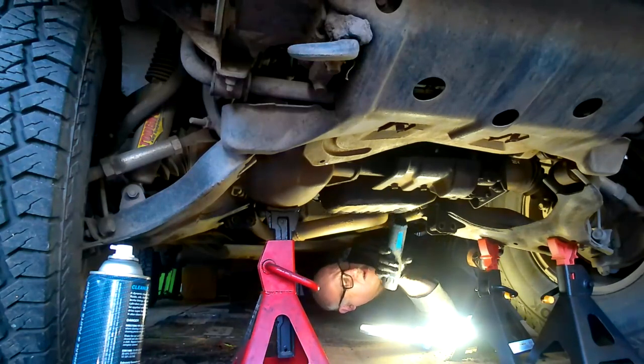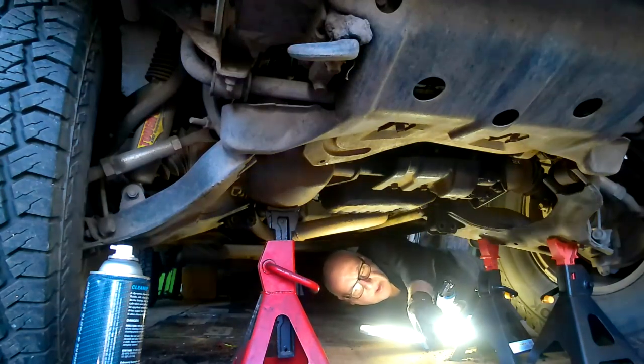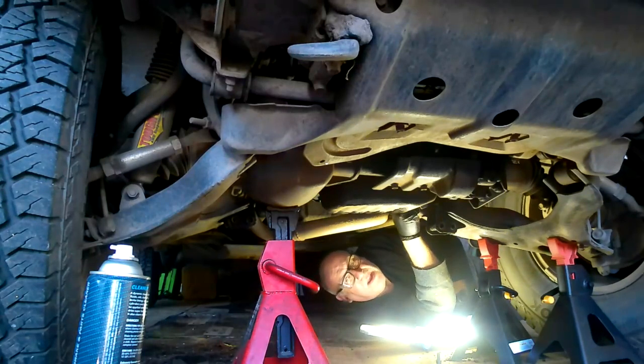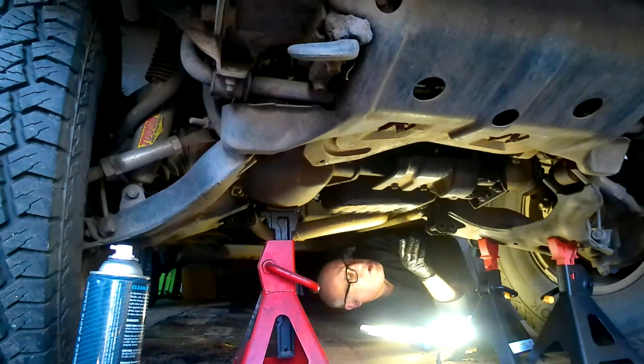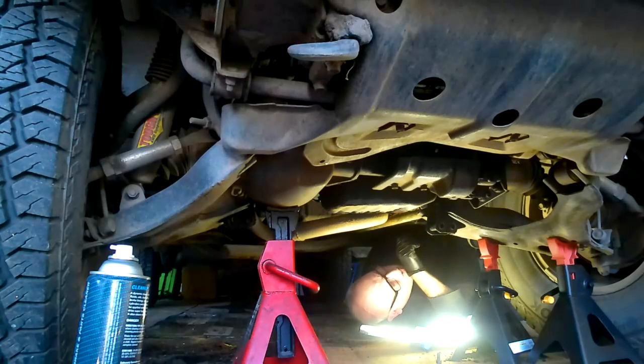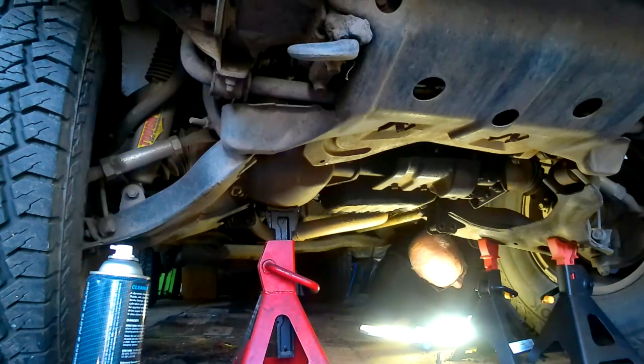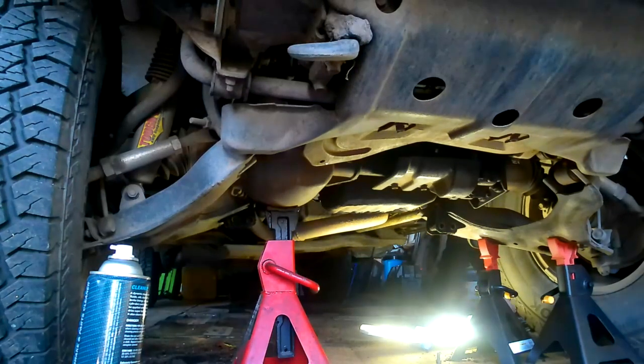And there's the bolt. Now if that's loose, it will pull apart here. There's a joint there, and I should be able to just drop that out of the way. I don't need to get it right out of the way, I just need to move it out of the way. And then there's probably an O-ring in there. I might need to tap it up with a hammer, we'll see. And then I should be able to get into the 2 bolts on the starter motor. And then I only need to get rid of the connections after that.